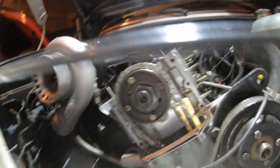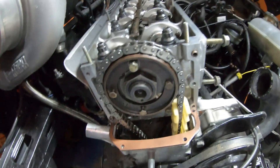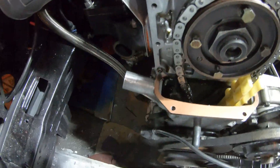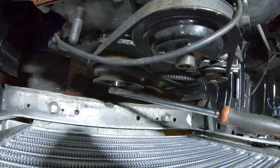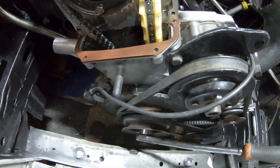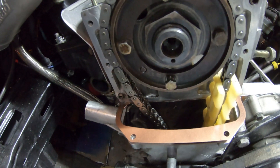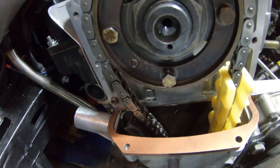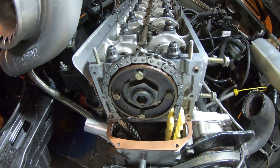I got them started. I don't want to bore you guys with just me tightening down four bolts, but once you've got those snug, throw that tensioner back in there. Then double check — turn it over a few times, make sure everything's spinning and nothing binds up. Triple check your work: make sure that lines up down there along with the dowel being at roughly seven o'clock position. Otherwise that's it — pretty simple for the M30.